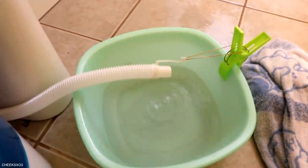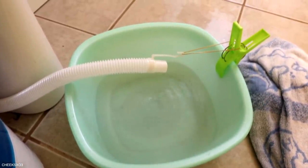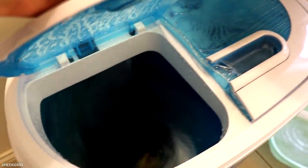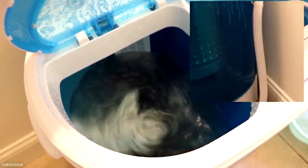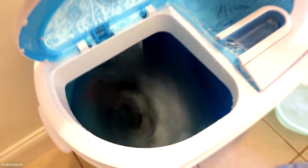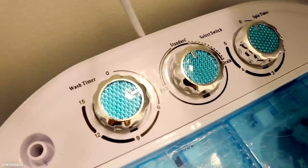Don't make the same mistake I did — there wasn't any warning in the booklet either. I didn't need to take out the drainage hose or drain any water until the washing was done. Originally the hose was standing upright, so the water won't spill out because of gravity. I took it out because I thought I had to drain the water while it was washing — that's why it flooded my bathroom. One cool thing: you can open the lid and watch it wash, but don't leave it open too long because it does splash. You can see through it and watch your clothes being washed.